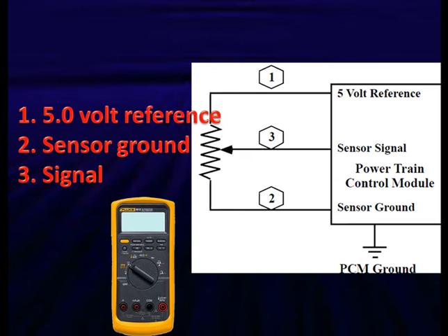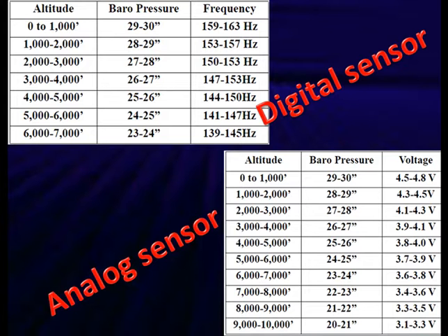If we have any doubts, one of the tests we do is take the sensor out, loop pin 1 back to pin 3, and see if we can read 5 volts. Then we take ground pin 2 to pin 3 and see if we can read 0. That tells us all the circuit's working and the system should be able to read. So let's look at these charts.